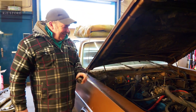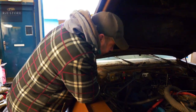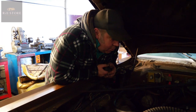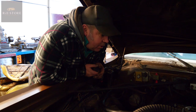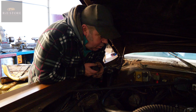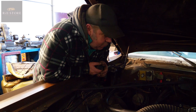It was a bit of a beast, isn't it? Yeah, but they changed the carb on it. Put an Edelbrock Performance manifold on it and a big four-barrel carburetor which they never had. But none of the choke was connected, all the kickdowns not connected. So I've just got to make the choke work and all the throttle brackets and all that really.